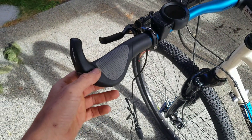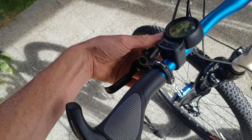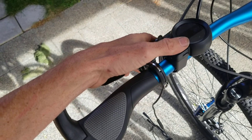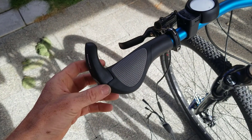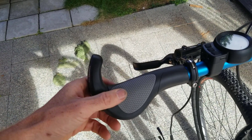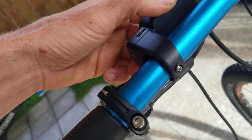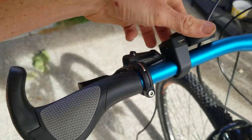For the display on the left hand side, all I've done is slacken this off and make sure it's nice and loose. I'm putting it inside of the brake because I'm not going to be using the buttons that often. Having the brakes nice and close to the grip seems to be the best option. Everything's loose — I'm just going to get it in the right positions and then snug everything up using Allen keys. The one underneath is super tiny though, so you need a really small Allen key for that.